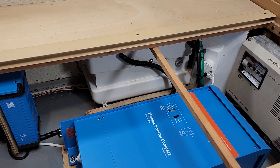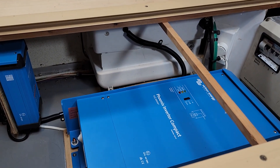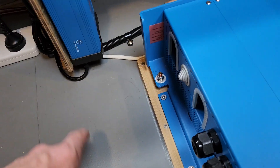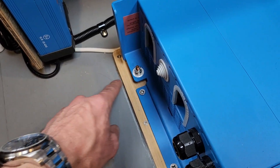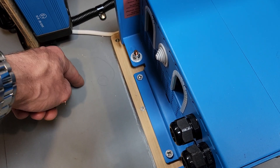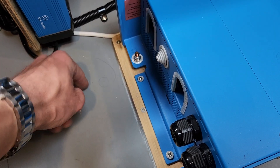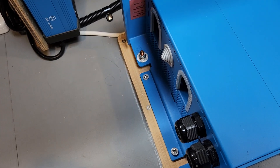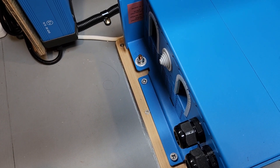It's very close to the battery bank, which makes it easy. Very close to a good earth too — all I've got to do is drill down here through to the chassis. The chassis rail is not far away at all, so easy peasy to get a good earth.